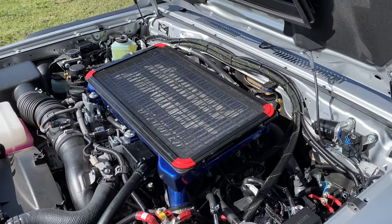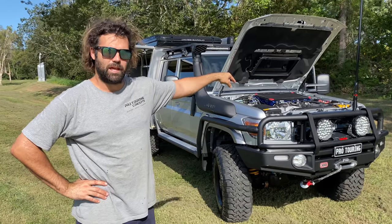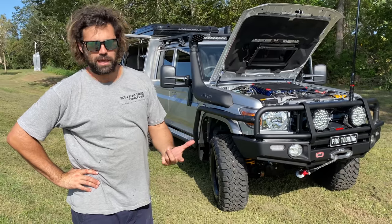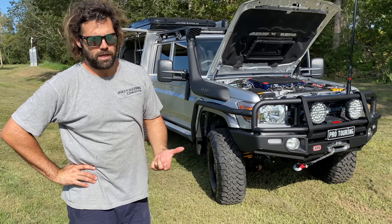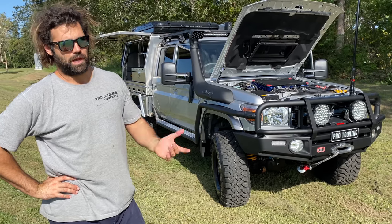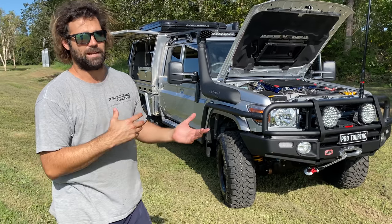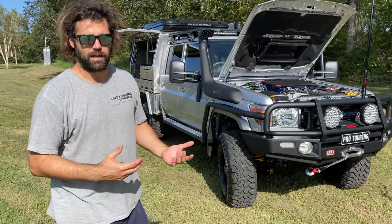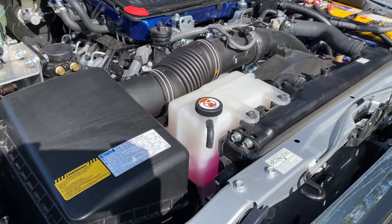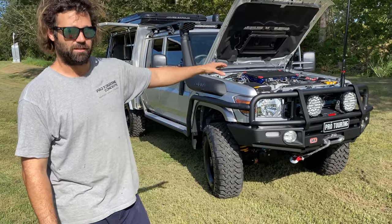As far as performance goes, it is a DPF-back ECU tune. We put the DPU high-flow intercooler on top. There's the catch can, we've got a fuel manager pre-filter in there, and an NPC clutch as well. The NPC clutch is normally part of the J-Max conversion, but because we're doing the performance package, it's either done through J-Max or through DPU — either way, it needs to be in there to handle the extra power. We also upgrade the crank battery to a better high-cycle, high-crank unit, which is better for running winches and any roof lights.